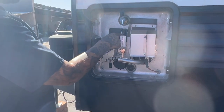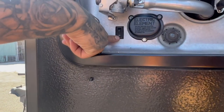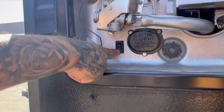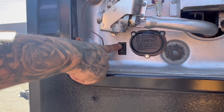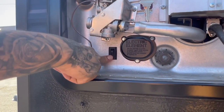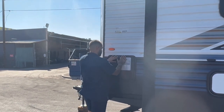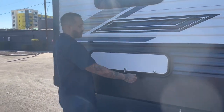There are thermostat switches here. One big thing to keep in mind is this switch right here — this is for your electric hot water heater. This trailer has the capabilities of a travel trailer camping RV, so you have the ability to run your water heater off electric and propane. Make sure this is on for electric operation.